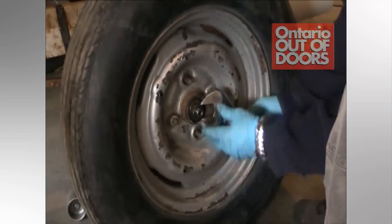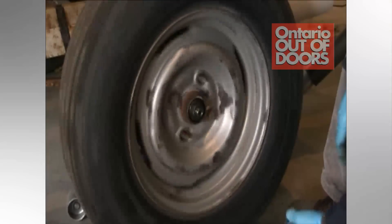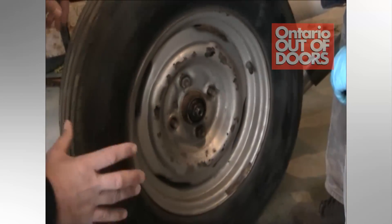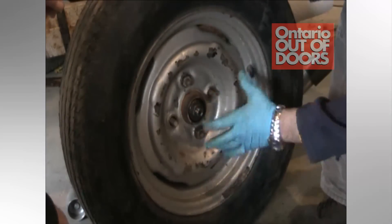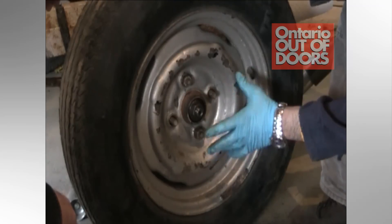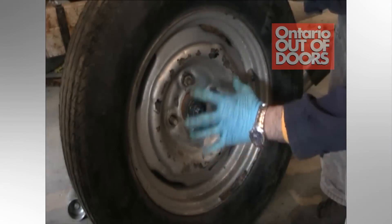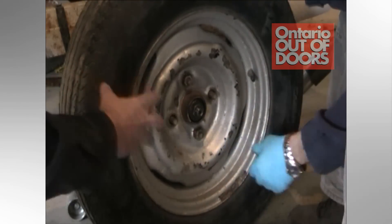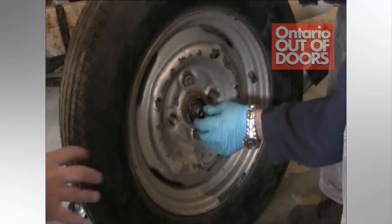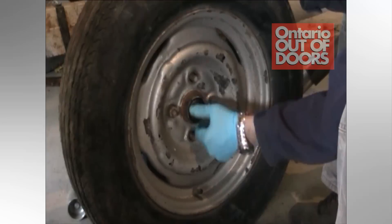Start by backing it off a quarter turn — now you'll see the tire is spinning nice and free. When you install new bearing assemblies and new races, they could find a different seating position once you put some kilometers on down the road. So you'll want to check your tire and bearings after anywhere from 50 to 200 kilometers — by shaking the tire and looking for any grease that escapes or any heat damage. You might have to take the dust cover back off and readjust the crown nut, tighten it down a little more. But now you'll see it's nice and free and that crown nut is just basically finger tight.